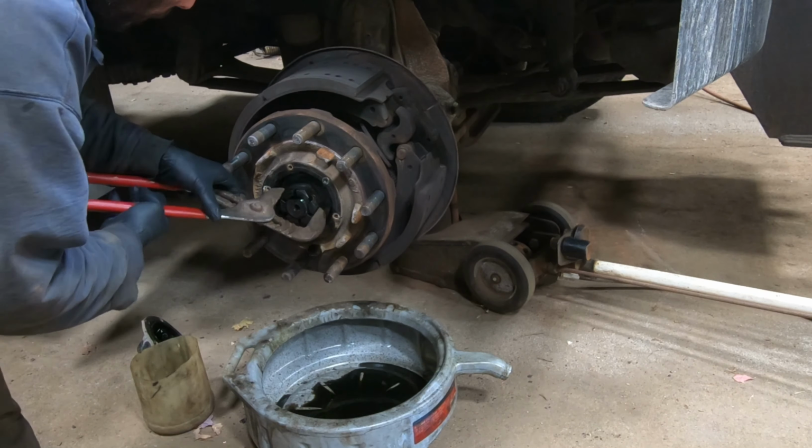So I was checking, I don't have any leaks anywhere. Cleaned all this off and I'm not going to be leaking anywhere over here either. Now when you fill this, you want to be aware of whether your axle is tipped one way or the other, because obviously fluid is self-leveling. If you're tipped back, then it's going to fill up the back more than the front. So when you come level, it's going to be overfull. So I would suggest keeping it at the minimum line until the wheel is down and on ground that you know is level.